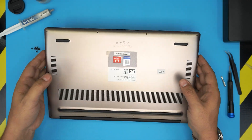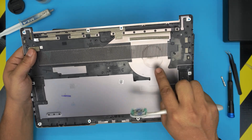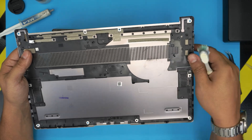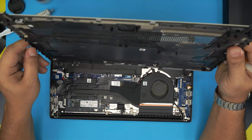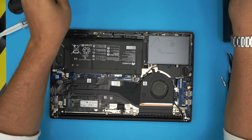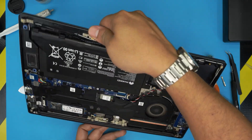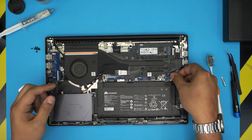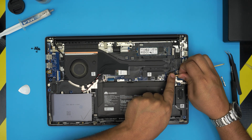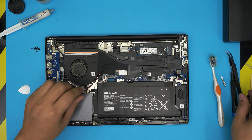Once you have a gap opening, grab the cover from the front side, bring it up, and wiggle it around — it will release itself on the back side. You can grab a toothbrush and clean up any dust in here. Now, before we do anything else, we need to disconnect the battery. To do that, pull the battery jack straight upward — use a piece of wood stuck right under the cables and pull them up towards the ceiling firmly to release the jack.